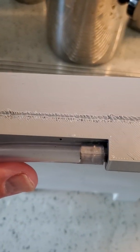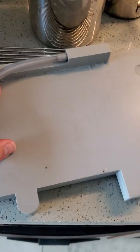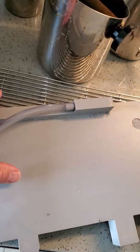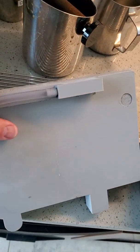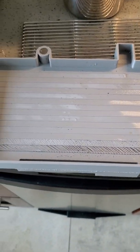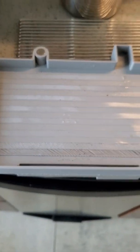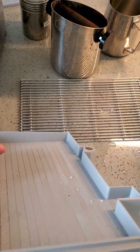You could put a little bit of silicone in there if you felt that was necessary. To join the two parts together — which are in the file on Thingiverse — I used a soldering iron and welded them together. You could also use plastic glue. The reason I did it in two parts is because the tray prints really nicely when flat on the bed; there would have been a lot of support material otherwise and it wouldn't have been a nice finish. Doing it in two parts makes the product look cleaner. On this prototype, the slope isn't super well printed — you could try printing it on its side if you want a better slope finish, though I haven't tried that yet.